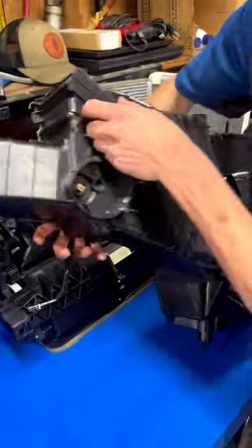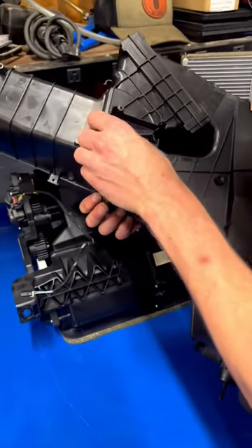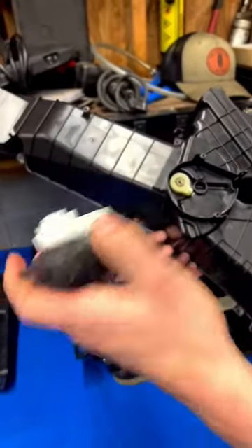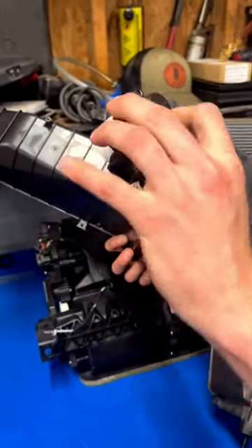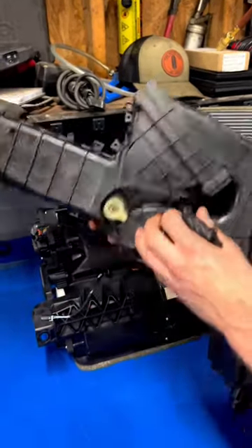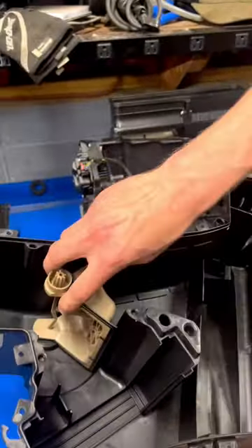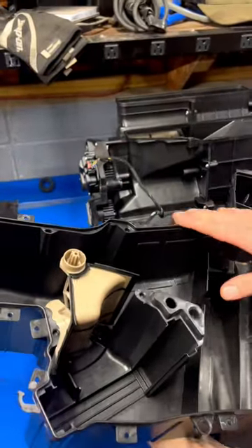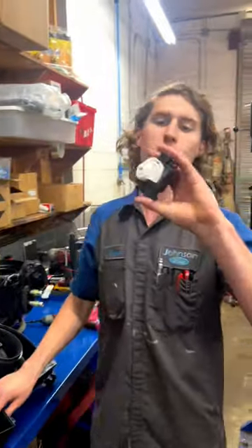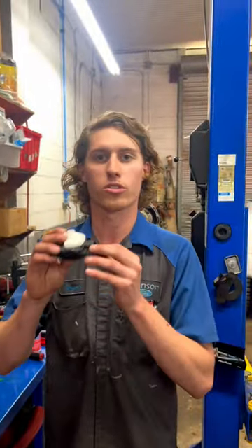This is going to go around to this side where we have a little peg that's going to pop on here. And then we're going to have our actuator — this is our actuator. This is what you're hearing popping inside of your dash most of the time. It's just a little electric motor that in turn twists and turns this door so you can get cold air during the summer and hot when your booty's cold in the winter. That is how a temperature blend door or any kind of actuator works on an AC system.